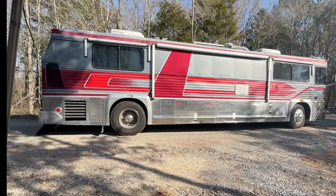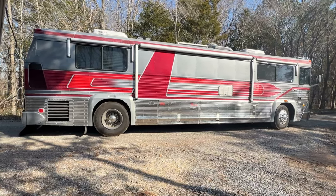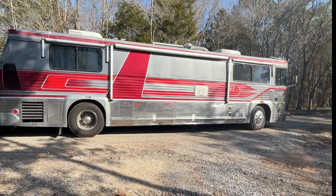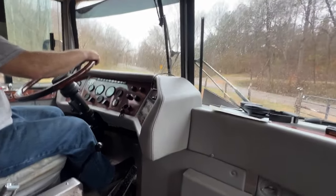About 60 seconds. All right, well, his Jake brakes were cutting off around 1700 RPM, so we made an adjustment to try to get down to about 1200 or so, and I just had to go in and readjust that, and we're gonna go for another test drive and test the Jakes. And then just leave it in first when you pull out here. Yep.